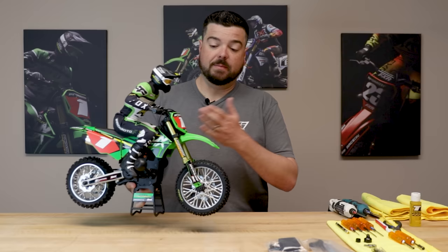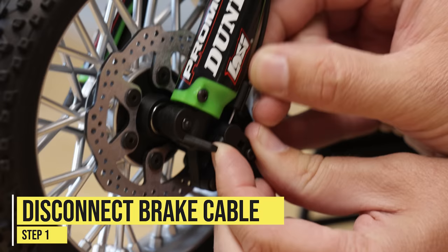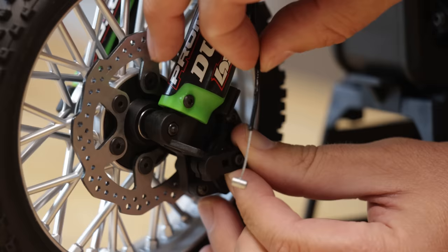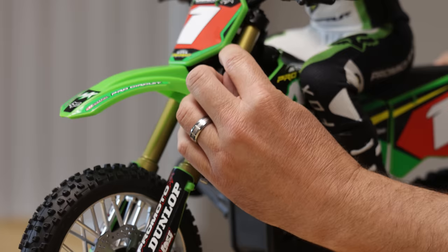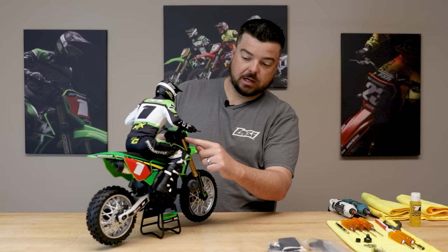The first thing we've got to do to maintenance the forks is get them off of the bike. I'm going to start by disassembling the brake cable here off the bottom. We'll push up on the brake arm and pull this black housing up until it comes out of the top of the guide housing. We'll slide it off to the side and get the brake cable and ferrule out of the bottom of the brake arm. Then there are triple clamp screws here — lowers and uppers — so we're going to go ahead and loosen those.